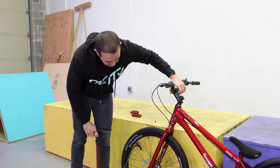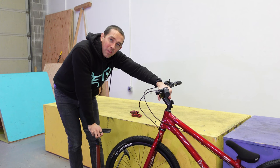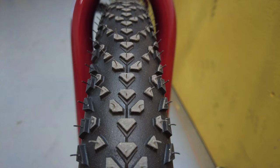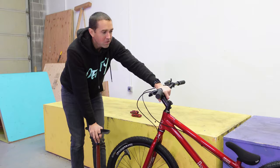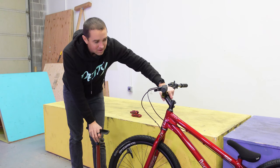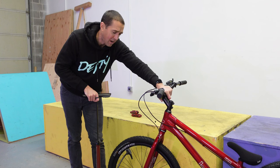Last piece to add is the pedals, then it's just tweaks — fill up the tires and adjust the brake levers a little bit. I'm going to start with about 40 psi in the tires and play with it from there; that's usually where I start with a street trials setup. One thing I'm noticing is that the tires are actually really thin — 2.2 inches. I'm an old-school trials guy who used to run 2.5s, so having thin wheels here feels a bit unexpected. I guess you want low rolling resistance for street trials, but I would have expected something a little beefier.